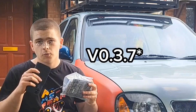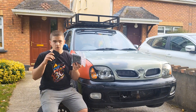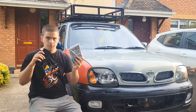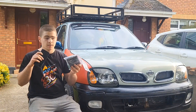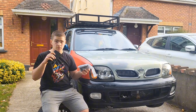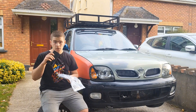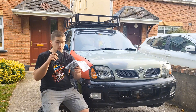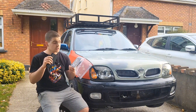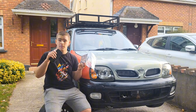Basically what this is is a Speeduino 3.7 version ECU board. In here I have all the components I need to build my own ECU. The most simple way I can put it is it's like a circuit board coupled with a little computer, and then you solder in a lot of electrical components like diodes and resistors and all sorts of stuff. You end up with a little tiny computer which gets information from all of your engine sensors and processes them to make your engine run. Once set up you can tune it using Tuner Studio, do your own map, and it's literally a fully standalone ECU but way less expensive. This isn't a sponsored video but I heard a lot of good things about it, so I'm really excited to throw it onto my car and hopefully get it running for the first time in over 14 months.